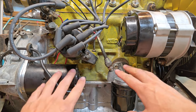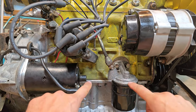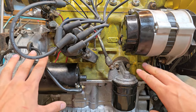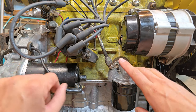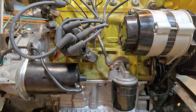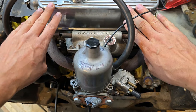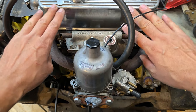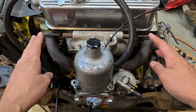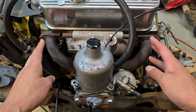Once the pressure gets down there, where does it go? It can either try to go back up against the rings, it can try to leak out of a seal somewhere along the case halves or the gearbox, or it can go back up through the tappet covers, through the pushrod holes, working its way up the backside of the engine, and gets back into the valve cover area. If it has nowhere to go, it'll cause oil leaks all over the place — it has to go out somewhere, so it'll find the weakest spot and just leak.